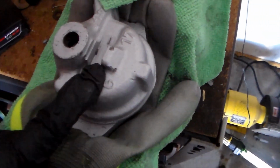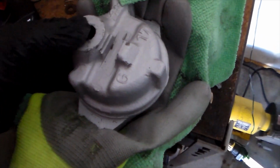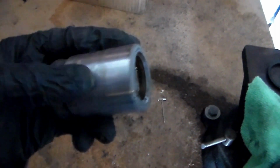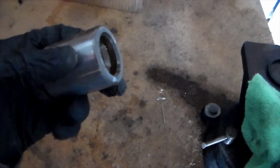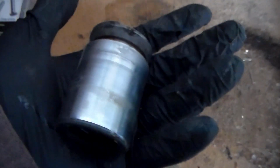But yeah, I'm going to go ahead and remachine this bore of the cylinder, just to make sure it's nice and clean. Wipe it down with some alcohol, and then I'm going to rebuild the piston. I know I already showed you guys, but after inspecting it more thoroughly, after it's cleaned off and dried, it feels pretty rough, and there's some pretty apparent pitting on it. So just definitely not something that can be reused, and something you can very clearly see right here. There's some divots in it. I know this is at the very bottom of the piston, so it wouldn't really affect it that much, but knowing that any damage is done to this, it would be something I would replace personally.